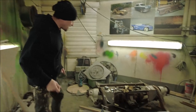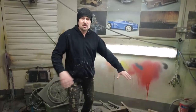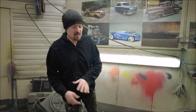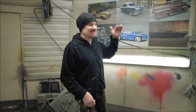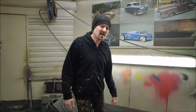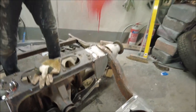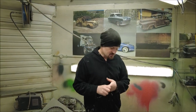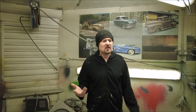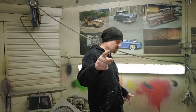We've already got the Jag back end in it. What this buys us is a lovely unit that can be welded in - we're keeping it in its cage. Don't forget, this car is super low, no one's ever going to see it, but it's going to be fully painted and detailed though. I'm aiming for that Ring Brothers thing - the Ring Brothers are just so good. I want to try and have a go at getting a car as good as that, and that's what this is going to be. It's never going to be as good as the Ring Brothers - they're geniuses, I'm just a man in a shed. But you've got to aim high. This narrows the track of the car by seven inches. The rear taxi axle was on a two-to-one ratio, probably because of that big plodding diesel power. But boom - Jag back axle in. We'll be doing more on this and the full rebuild in future.